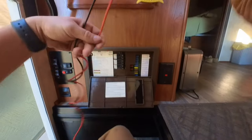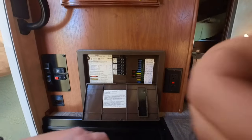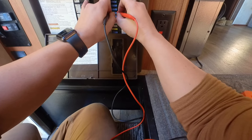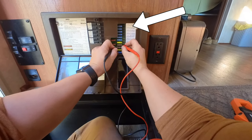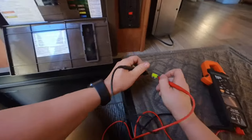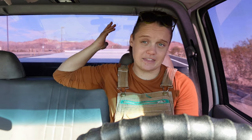The next place I usually check are the fuses — that's my go-to starting point for most electrical problems in an RV. We double-checked that we were getting 12 volts to the fuse panel, then verified all fuses are good. I ignore the labels and just test all of them — it's faster. I've actually had customers where I showed up for one thing, found a blown fuse for something else entirely, like lights that hadn't worked in years, and fixed that as a bonus.